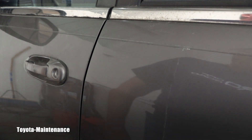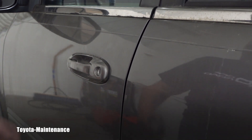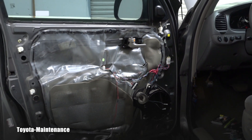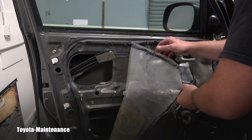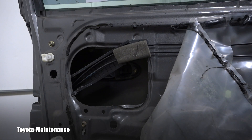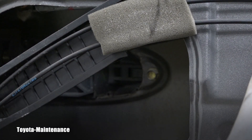I know it's being held by two bolts from inside. Unfortunately this includes removing the door panel, that's why I didn't take care of it immediately. But now the door panel is off, as you can see right here, and we can finally take care of this problem. I'll go ahead and peel off the moisture barrier from this area — the handle is right behind there. I can actually see that gold-colored bolt which is holding the front of it.